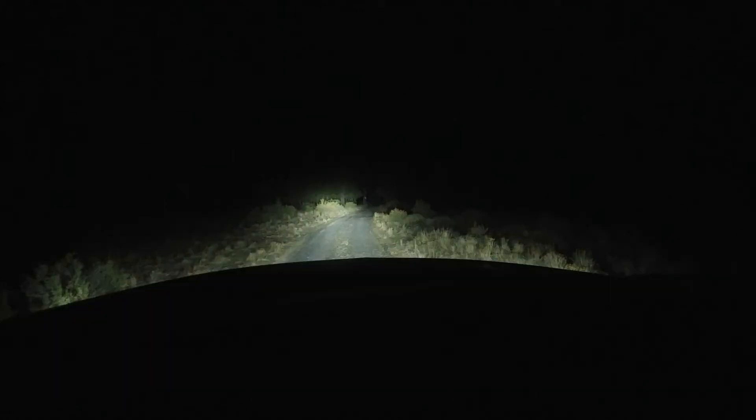When you switch over to the 4WD Kings LED high beam headlamp, what you'll notice is the contrast immediately changes because it's a 6500K white bright LED light. You can definitely see the green compared to the gray road, there's definitely contrast between the brown grass, and even at the periphery you start to see the difference.